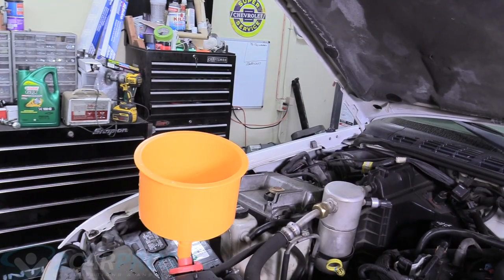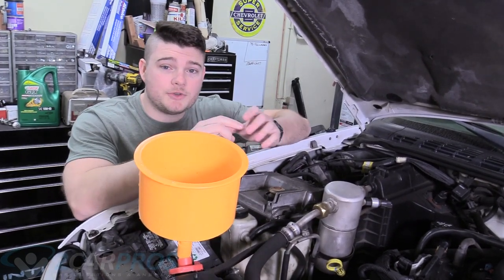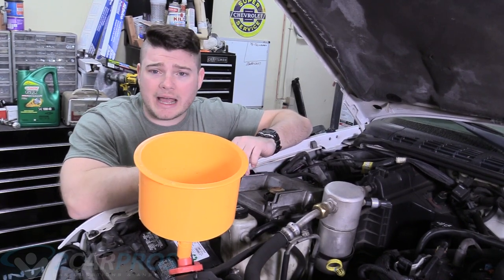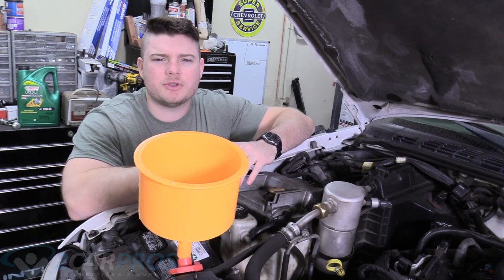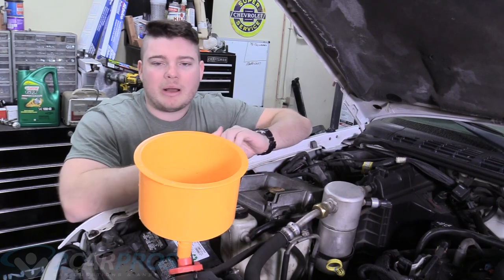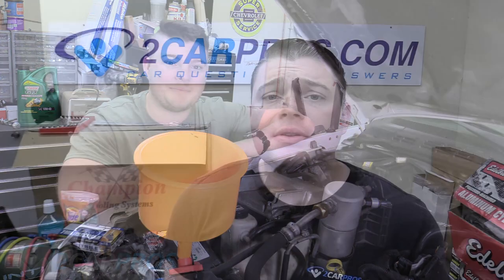It's been about 10 minutes. I'm going to go ahead and shut the truck off. Now what we can do is remove our water once again after the engine has cooled down to an appropriate level — it's at about 130 degrees right now, which is just warm enough to scald you pretty good. So we're going to let that cool down, drop the water again off camera, and then we're ready to move on to our head gasket sealant chemical step. That's how to prep your coolant system for using the head gasket sealer, which is a really cool alternative to actually having to do a head gasket.